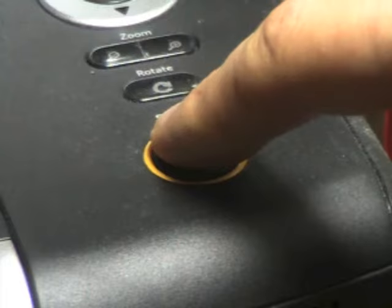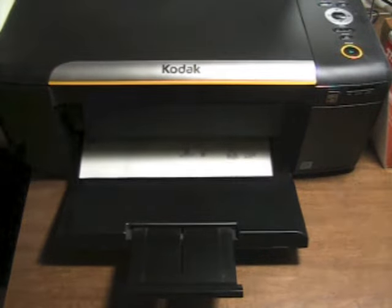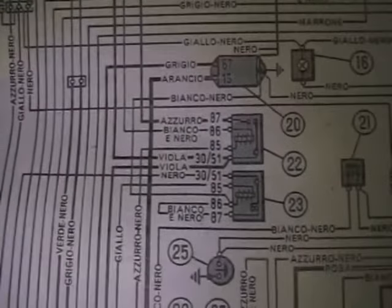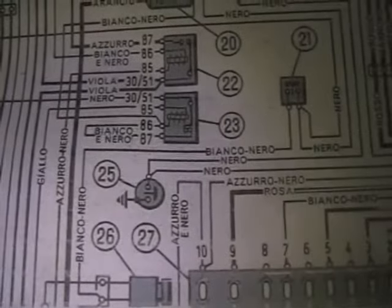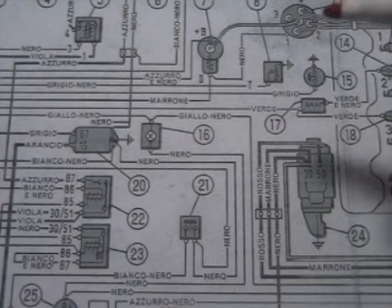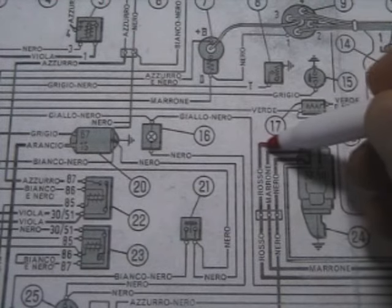Position the diagram, load the paper, and you're ready to go. Grab your printout and make sure it has the section that you're interested in — we're going to be looking at these two relays marked 22 and 23. Next, grab your favorite set of colored markers or colored pencils and we're going to start filling in those lines and translating as we go. You can practice on other sections of the diagram that you're not using right away.